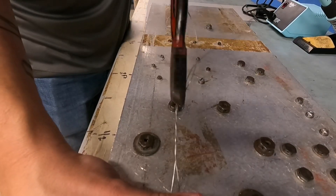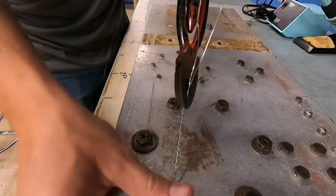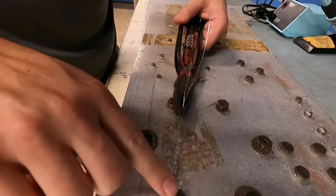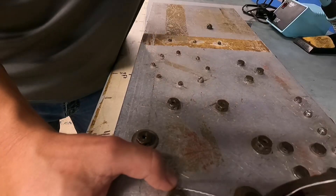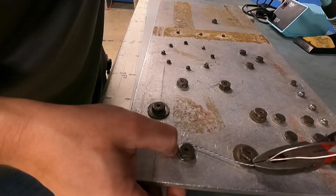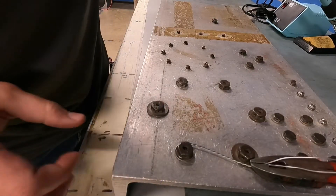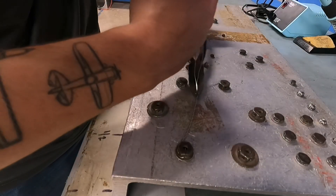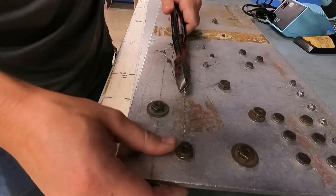Then you're going to start your process of spinning your wire down. If you're doing this by hand, I've made that full-length video on it — make sure you go check it out. I talk about the placement of your hands. That's about six to eight wraps per inch; you can put a knuckle in there and count them. I'm trying to keep it as parallel, or as 90 degrees as I can, to the bolt. When I pull it around to come over here it's going to tighten this wire up a considerable amount because it was coming straight out — now when I pull it around it tightens up so it doesn't want to come back over the head of the bolt. Starting at 90 degrees to the direction you're going to pull the safety wire around is a good check to make sure you're going in the tightening direction.